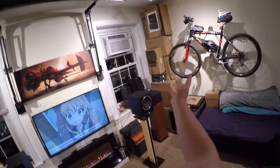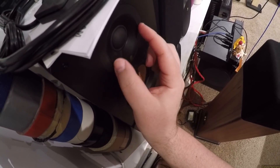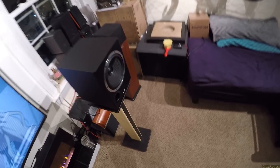The problem with the Canto Bends is the same problem here — it's why KEFs are such amazing speakers. KEF puts the tweeter in the center, uses a coaxial design, and literally built their entire lineup on that design. Stage Right and Monoprice just sort of went, 'I don't know, do one of those.' The problem is the waveguide — you see the tweeter and this little ring cone around it that directs sound outward. This has a little ring waveguide around the tweeter, but it also has this giant six-and-a-half inch woofer directing sound forward, so these essentially become sound cannons.